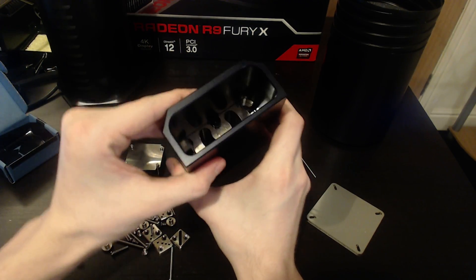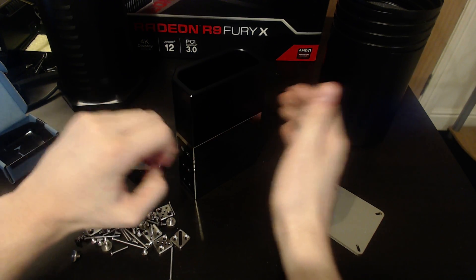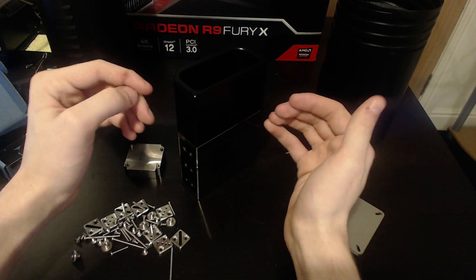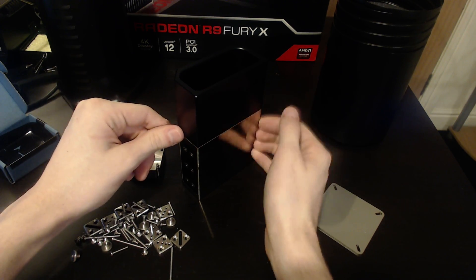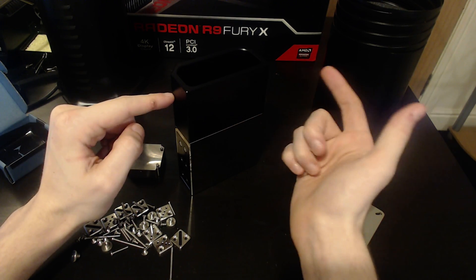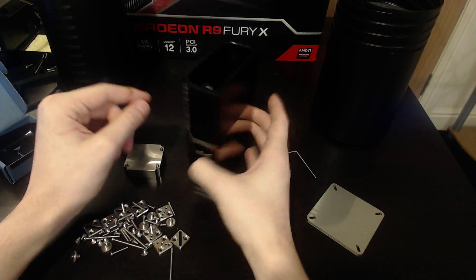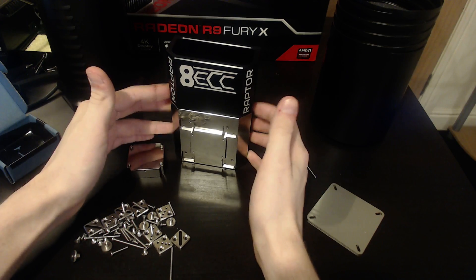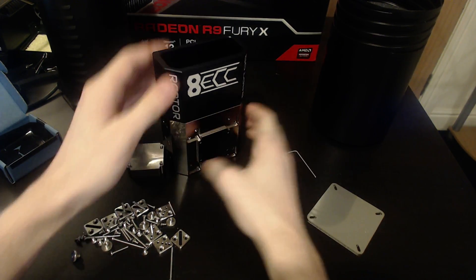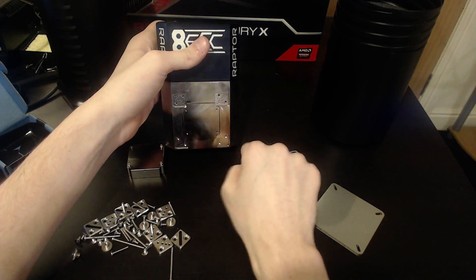All these extra CNC angles ensure you get more surface area, but they also make it possible to keep a lot more of the pot's mass. With LN2 pots, you want two things: a lot of mass, and a lot of surface area. Mass makes the pot predictable as far as temperatures go, because it takes a lot of heat to change the pot's temperature. A lot of surface area means that when you pour LN2 into it, the LN2 very quickly dissipates any heat. So to achieve both of those, this is CNC'd from four sides just to get the internal structure, and this side is also CNC'd to get the mounting system in place.